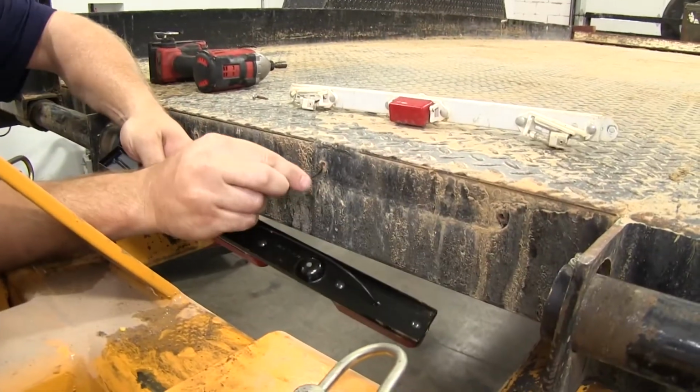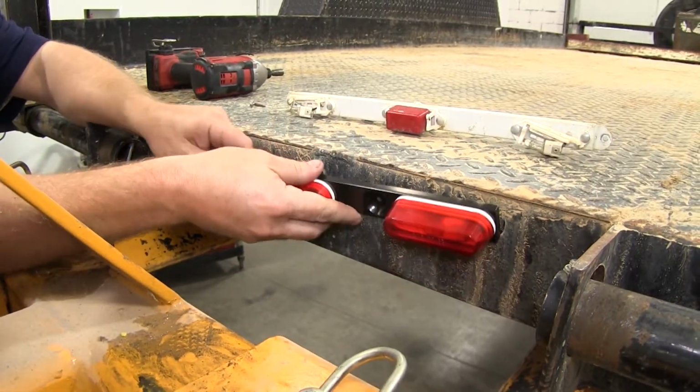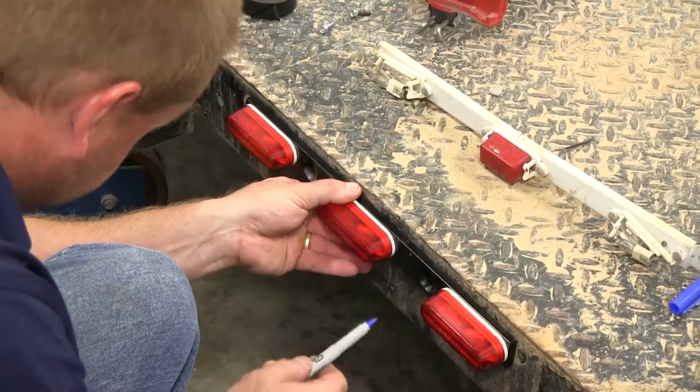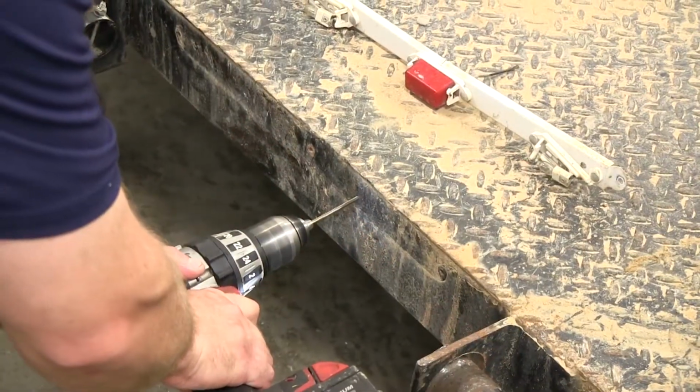Now before installing the actual new light, on this trailer there was already a hole where we'll be able to push the wire through. The grounding for this light will be done through the two mounting screws as it mounts to the trailer. Now to keep our self-tapping screws from breaking off in the trailer, since this trailer has a rather thick wall to the frame, we'll go ahead and pre-drill the holes